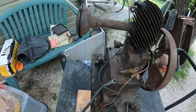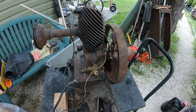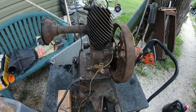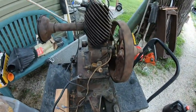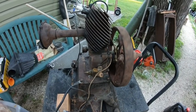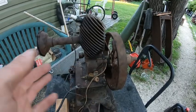You can see I spilled some gas there a little bit. We're going to see if it runs. I right now have one turn on the needle valve. I have the choke about half. We'll see what's going to happen. So I did go correct the, I think I said earlier on that the commutator was moved up. I pushed it back.